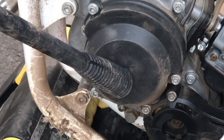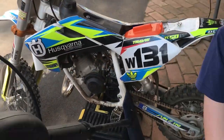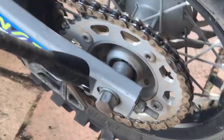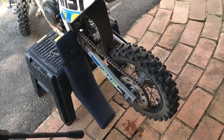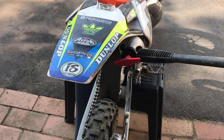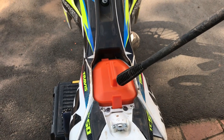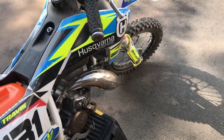This box always gets water in it — that's where your stator lives and it needs to be cleaned out periodically. At the back of the bike there are also bearings, so if you sit here and spray high-pressure water into the bearings you're going to be replacing them a great deal. On this side, even if you have a plug, you don't want any water in there. Limit the amount of high-pressure water in this area because you definitely don't want water going into the airbox. So that's about it — we're going to proceed now with a simple rinse first.